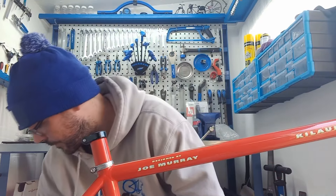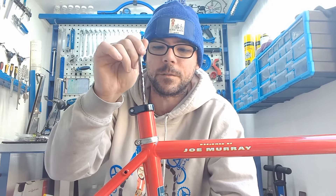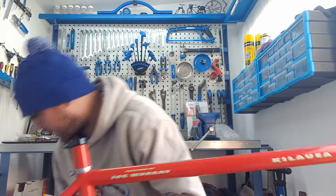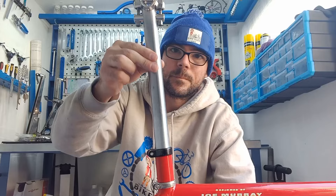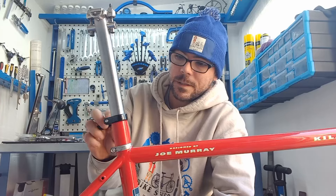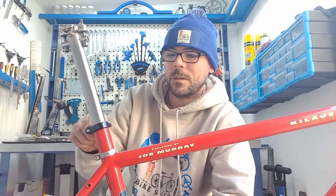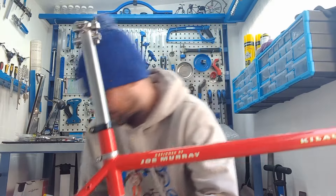Make sure that's all lined up. With this frame I'm going to do a little bit of invisiframing and some wax oiling as well, just to preserve it longer for the future. I need to put the seatpost in, so I've just applied a tiny bit of copper slip in there. That'll be enough — all we want is just to nip it so I can put it in the bike stand and move it around safely, do the invisiframing stuff and wax oil it. That's in and on.